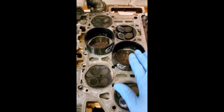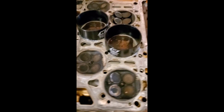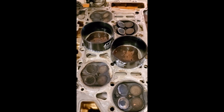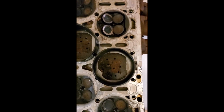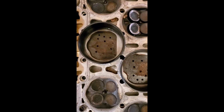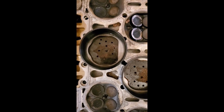Okay, I'm going to take these piston ring compressor tools down to the cylinder head. I put a little silicone around it to keep the second casting from leaking out, but these worked out pretty good because all around you can see that it simulates the bore, and I'm going to pour that second stage in. I also drilled holes in it so that the epoxy can sink down into the pores and help it stay bonded together to the first piece.